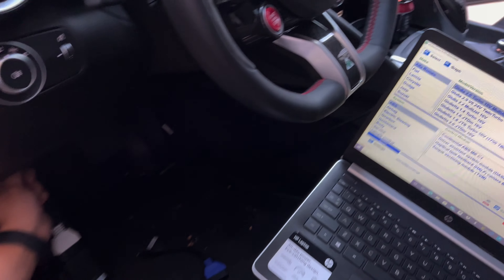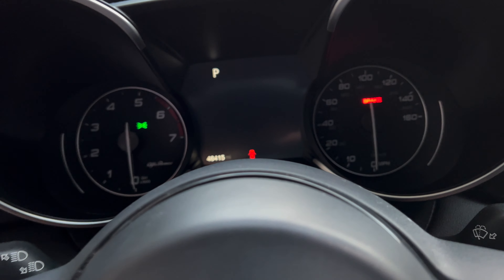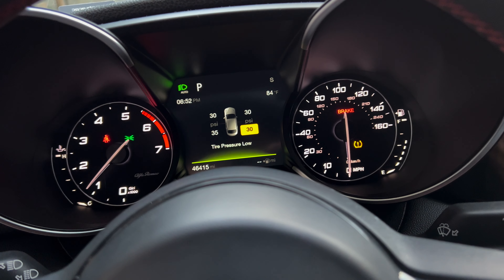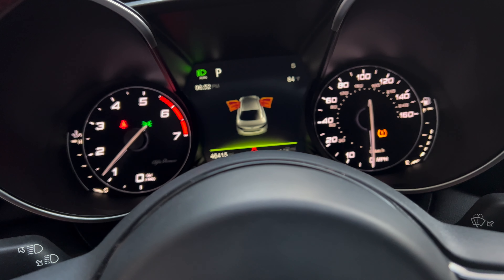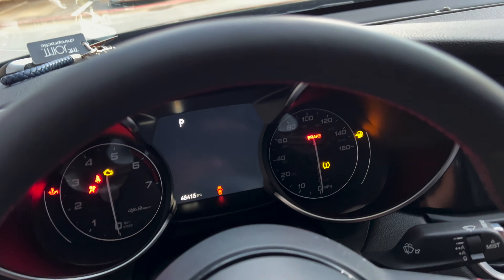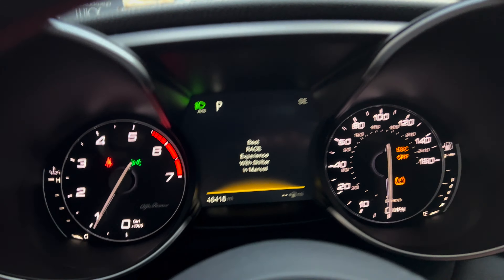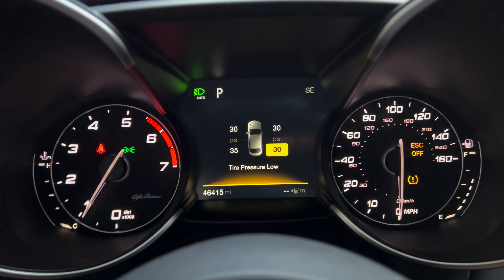Pop this guy out and turn this off. I restarted the car about ten times — I think you only have to do it once. Turn the car back on fully with foot on the brake, all your warning lights will disappear. Turn it back on one more time so you guys can see it's in race mode. It'll say 'Race Mode Manual' and then tire pressure.